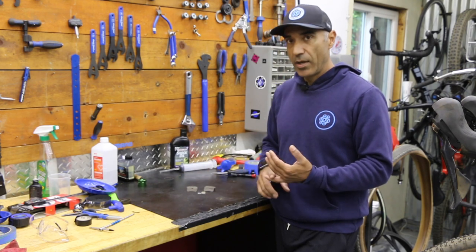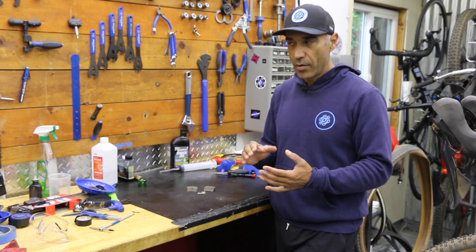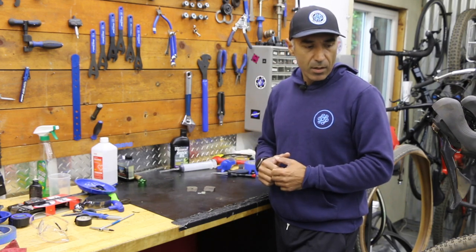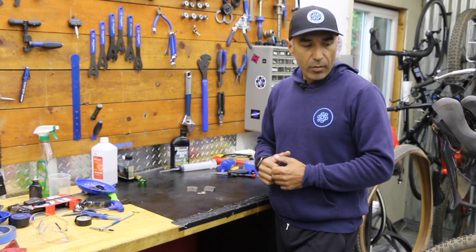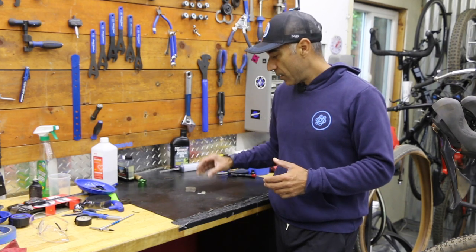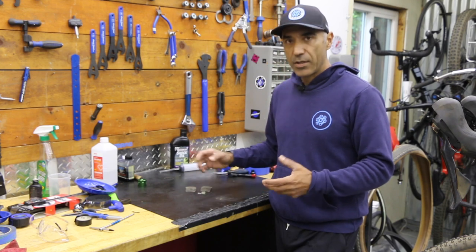And it may be dependent on your rotor too. Your rotor may say resin only. So far I've only seen that on the logo writing on Shimano stuff, on maybe lower mid-grade stuff. I tend to like the metallic because I want that sharp bite.